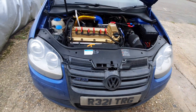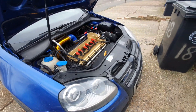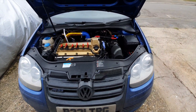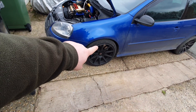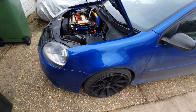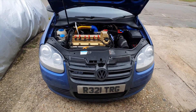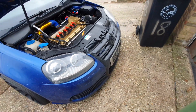The car's been filthy - I've been driving it to work for the last four weeks, twice a week, and went to Wales as well. It absolutely performs faultlessly apart from the obvious gearbox issues - drove about 300 miles in a day with no issues whatsoever. What I'm going to do is start by cracking the wheel nuts on the front and the drive shaft nut while it's down on the ground, then jack it up onto axle stands and remove the front end completely - bumper, crash panel, radiators, the lot - just so we've got plenty of access to slide the gearbox in and out.